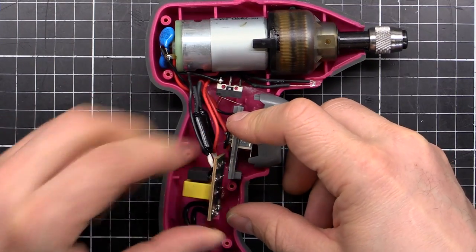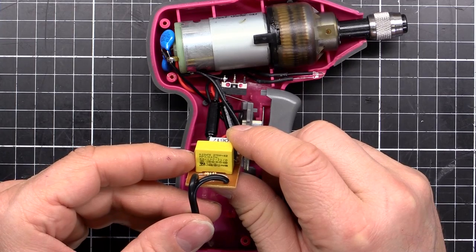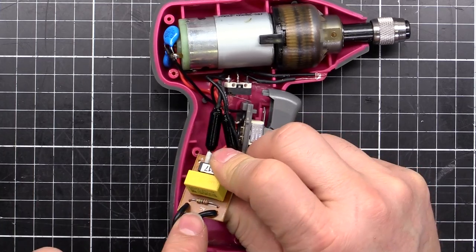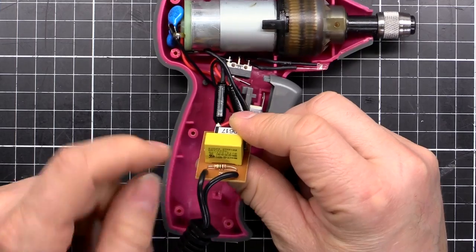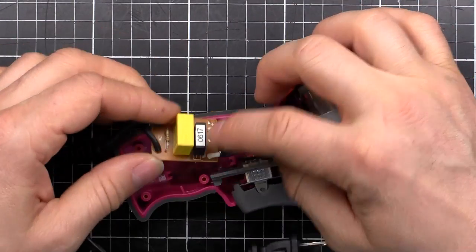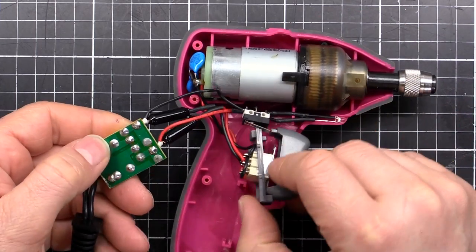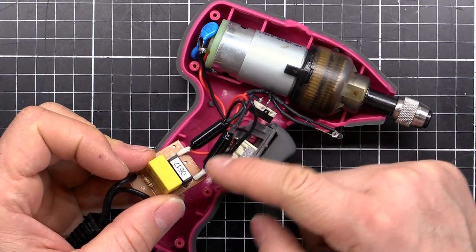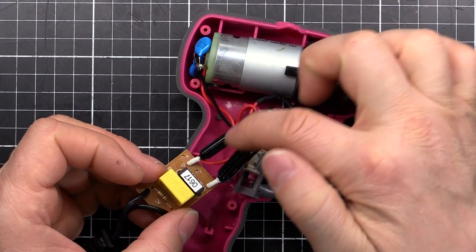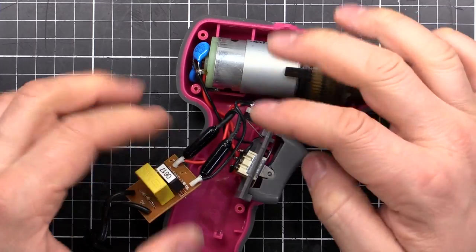This little circuit board is the first thing in line. We've got a capacitor across the mains — that's going to be an X2 rated cap, 275 volt rated, 0.22 microfarad. So it's a standard noise suppression capacitor with a 1 megaohm resistor — brown, black, green — just a bleed resistor straight across the mains. That's actually before the switch, so it's always connected when your plug is in. Then we've got a bridge rectifier — that black one there — converting AC to DC, so this is a DC motor. From there we've got some ferrite beads with wire coiled around them, which are suppression chokes to stop any commutation or arcing noise from getting back out.